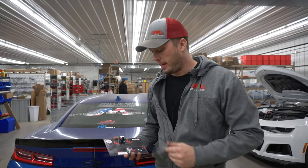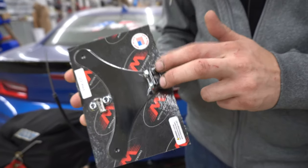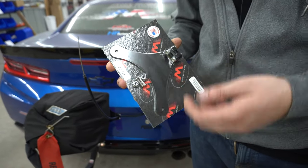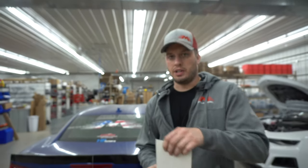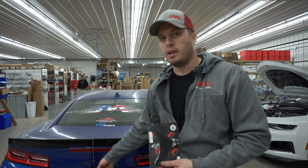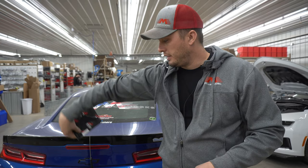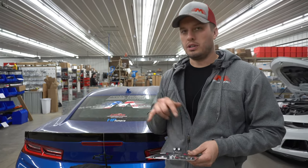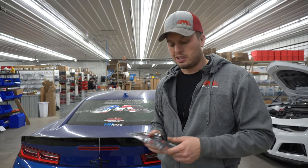So this is just a real simple mount we make. It's anodized black so it's nice and discreet. It's basically a billet clamp that goes onto a form piece and uses two pieces of hardware — it couldn't be more simple. It'll pretty much work on any single parachute mount because all you're doing is drilling two additional holes in the back of your plate or the mount itself, so it can be adapted however you want. If you have a Motion Raceworks parachute it'll use the same bolt pattern you already have, and it's only 29 bucks.